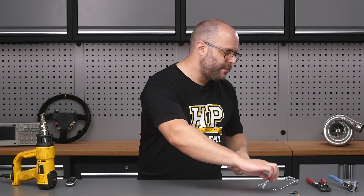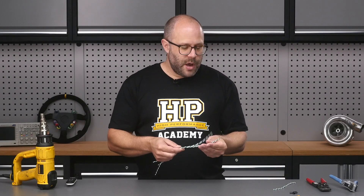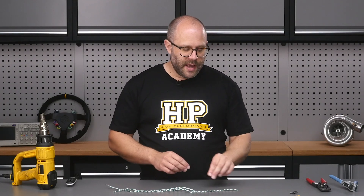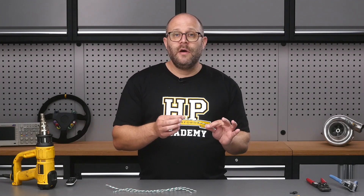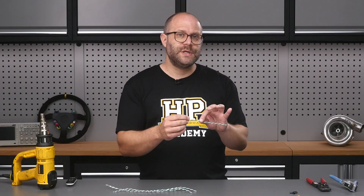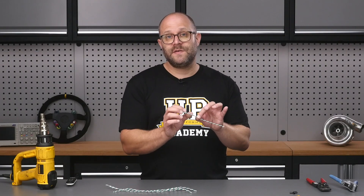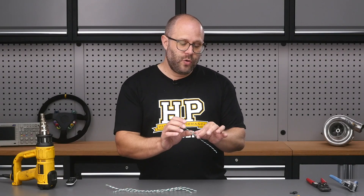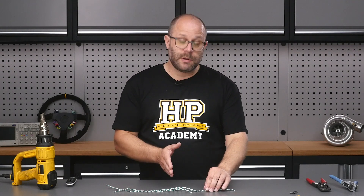I've got some example wire set up here — this is pre-twisted. We've got our three wires which are going to be on the outside and our one which is going to be on the inside. Often the inside will actually be very close to a connector body, so it's quite possible that these wires won't be twisted, because if you're placing that splice directly behind a connector body it's going to be much easier for these sections of wire to be straight and then be pinned into the connector. That's not going to cause any issues because the CAN high and CAN low wires are still very close to one another so they'll still see the same level of radiated electrical noise.